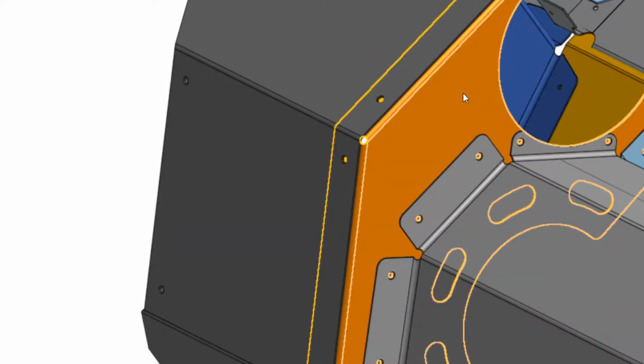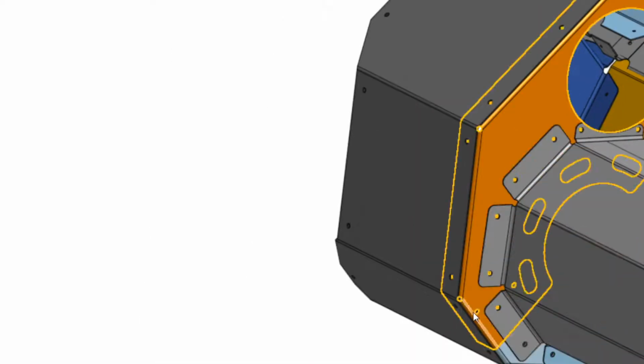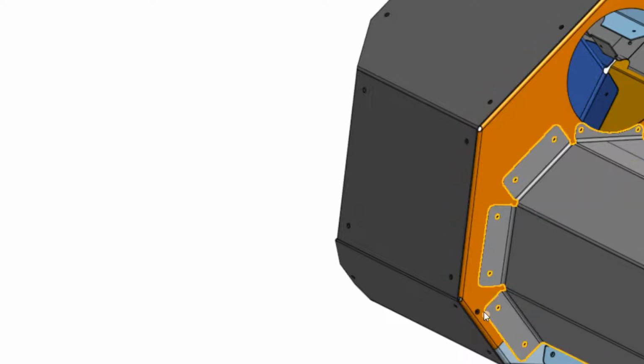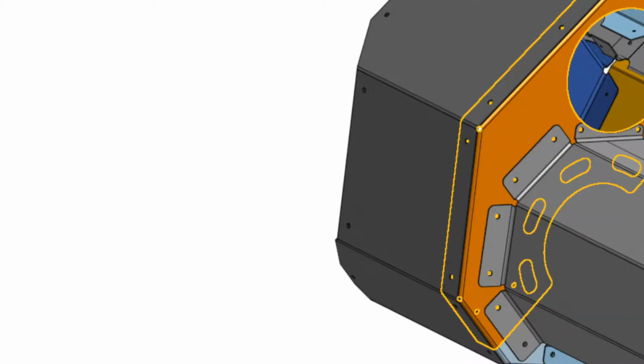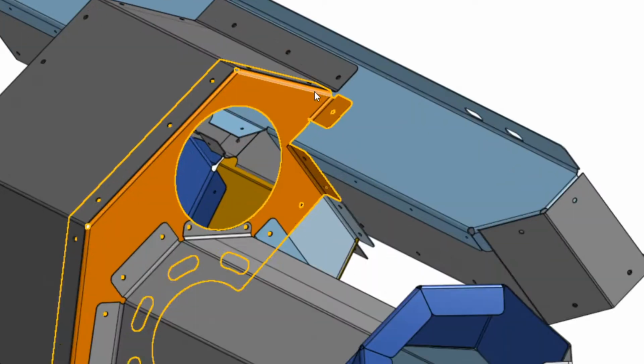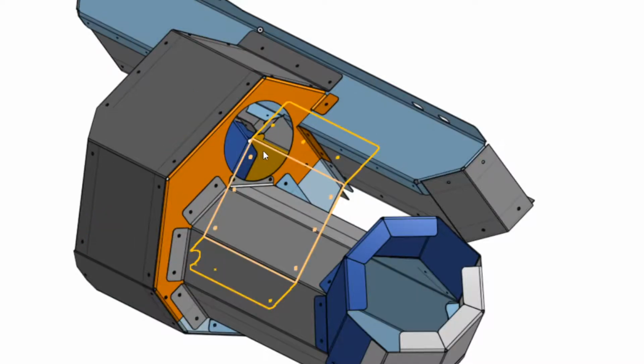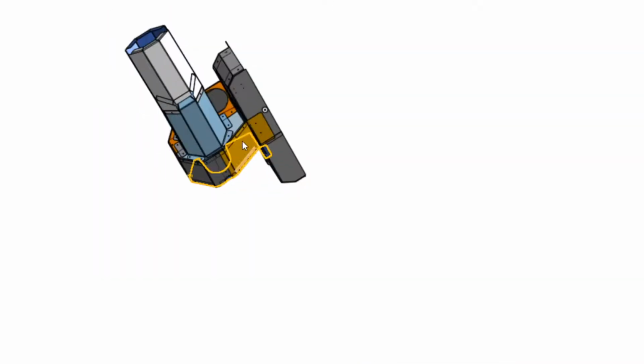So you can slip it on from the top. Again, you see the cutout where the exhaust pipe goes through down here. It should slip down over that, and the holes should line up, and you can screw it together from right to left, or outside to inside, with one screw here, another one there, and another one in here. So now if we get that much on, we've got the left and the right side of the exhaust turbine covered.